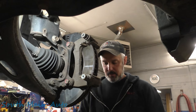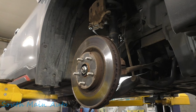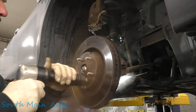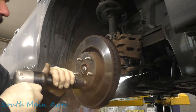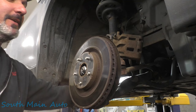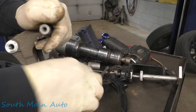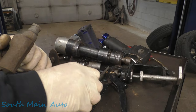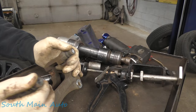I'm going to grab a 19 swiveler, pop the bracket off. Grab a leash because it's time to bring out the dog. We'll take the rotor off, peel the hardware off, and go stick it in the sandblaster like we always do. We're going to clean out where the pad ears sit and where the hardware sits — get rid of that rust junk. Then we'll come back, check our pins, make sure they're lubed up, and we're ready to roll.